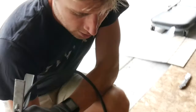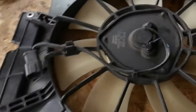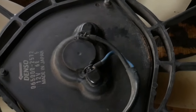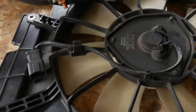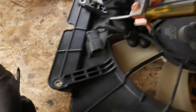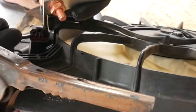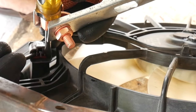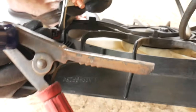I'm going to test this condenser fan motor. As you can see, it has a blue and a black wire. I'm not totally sure which one is positive and which is negative — I'm not an electrician — but I'm just going to hook these up, and if I have them backwards it just means the fan will run backwards and I'll switch them. Without touching my screwdrivers or clamps together, I'm going to insert them and touch the two pins. I can hear a noise inside the motor but the motor is not spinning, so I know that this fan is busted.